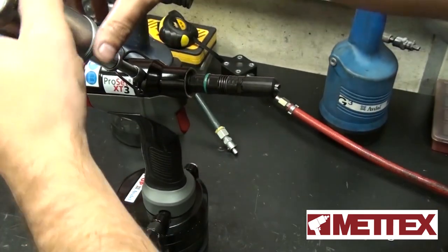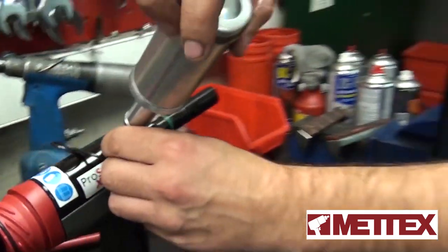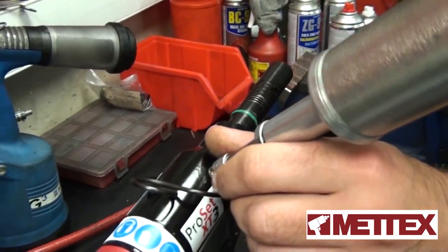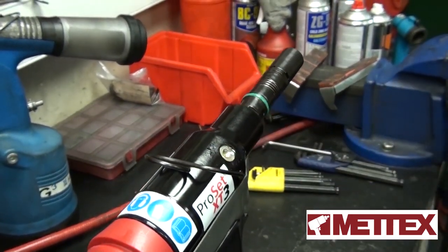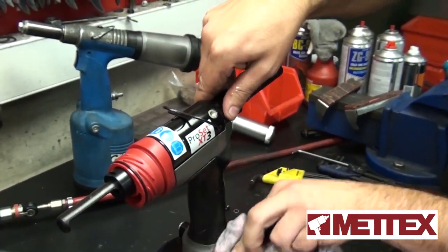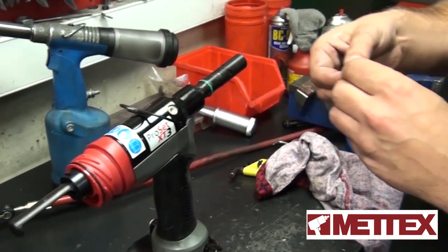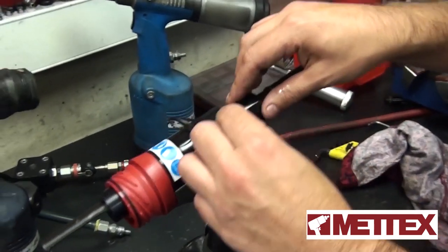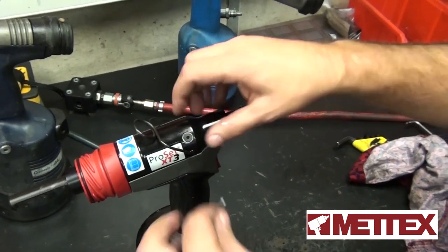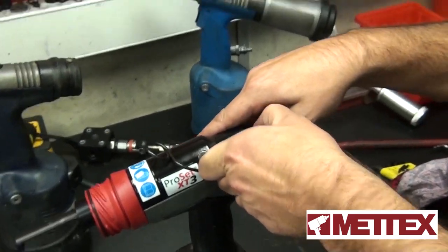There we go — now you can see the head moving. That's where you want to stop. Once you release this, you might get a little bit of a splash and the head will move back forward for any distance that it has moved. Then you just wipe up your excess. Place your bleed screw back on. Just give that a pinch up — you don't need to go over tight on that.